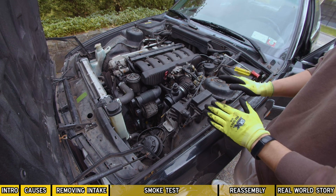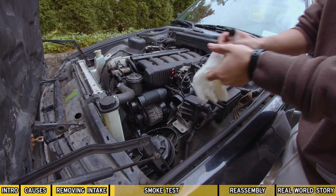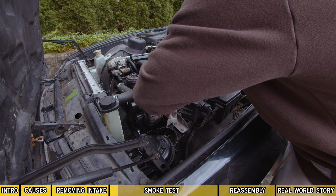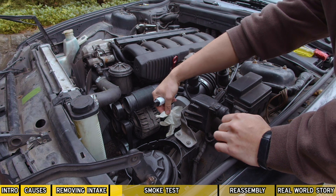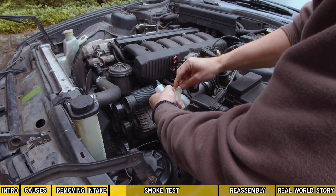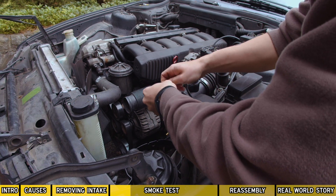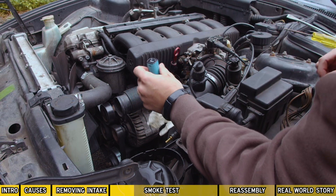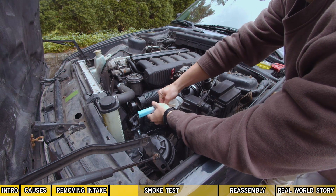We are finally at the point where we can use our new method. All you need is a rubber glove and the vape. You put the glove around the intake hose, around the mass airflow sensor tube. I saw a tutorial where they used the glove trick, but they used a $100 smoke kit. So cut a little tiny hole on the finger, put the vape mouthpiece around this — honestly, cover the whole thing. Once it's attached like that — this looks so funny actually — you just blow on the other end. So the pressure does push back.